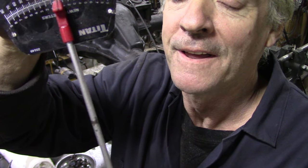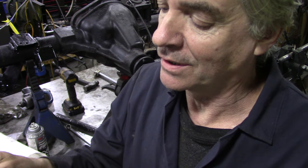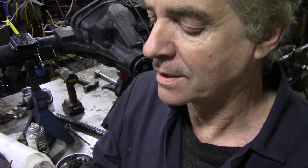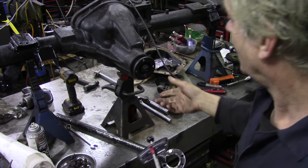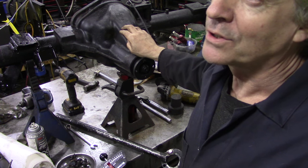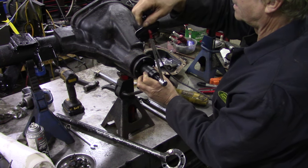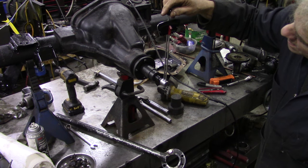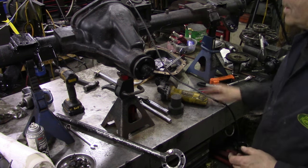I've got the advantage of having no differential in there, just the pinion. I'm going to use a quarter-inch drive beam torque wrench — you can see all the adapters I've put in there because I want a 32-millimetre socket on it. This measures Newton metres from zero to nine. When you set these flanges up and set the crush sleeve, it should be between two and four Newton metres to turn, and this one is showing one — so we've got a long way to go.